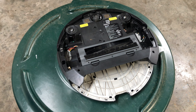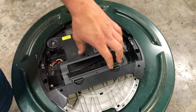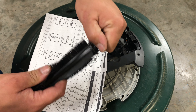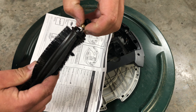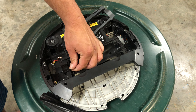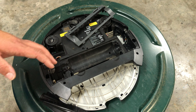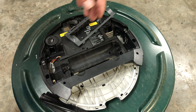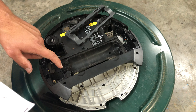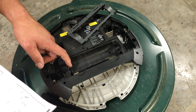Next: dock plus max plus exclamation point flashing means there's a blockage in the brush roll. Open it up, clean it out, make sure there's no hair. Remove the end cap — it should come out as one piece with the bearing. Clean all the hair off, spin it, and make sure the motor on the side is free. The housings on these go bad fast: if they get clogged and the amp draw on the motor rises it heats up and melts. I sell these and run out quickly — comment below if you need one.